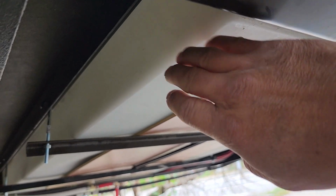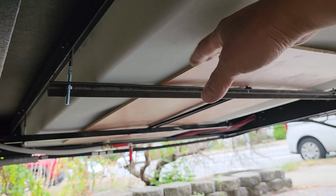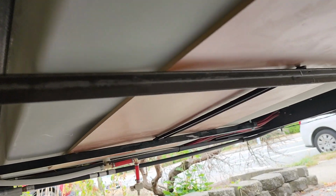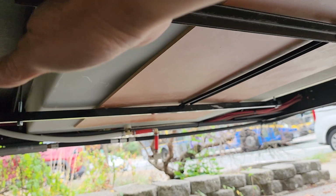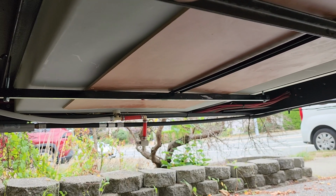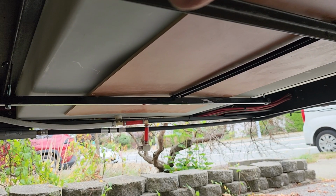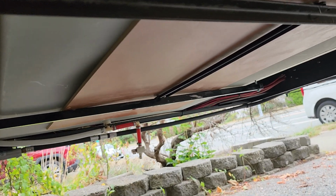But only half a year later, the plastic tank is sagging down about 3 inches deep from here, from the middle. So that way the water sitting there is dead water. It won't come out, cannot be used anymore. So we found out this problem.